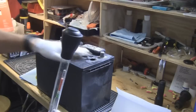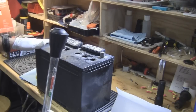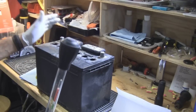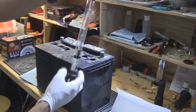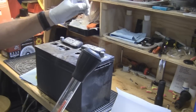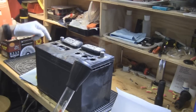Now, if the battery discharges, all the cells should be low, so they should all be about the same. But if the battery is fully charged and you've got one cell that's low, that's a defective battery — you need to get a new one. Using the hydrometer you can measure the density in each cell. I don't care about the absolute number; what I want to see is if one of the cells is low.